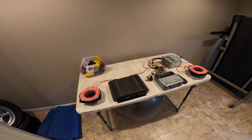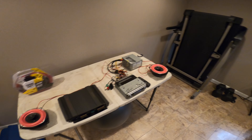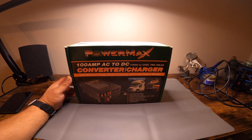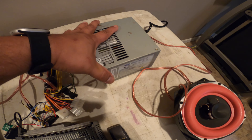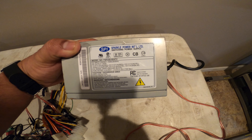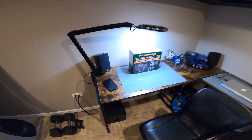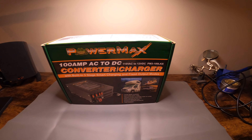What's going on YouTube, today we have a little bit of an upgrade for my car audio videos. This is what I'm talking about: a 100 amp 12 volt power supply. Before, I used to try to power amplifiers on this little guy here — it shows five amps — so there's a five amp small power supply. I would try to power a car stereo and a small amplifier and as soon as I turned it up it would shut off.